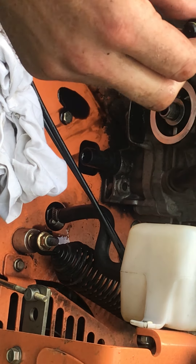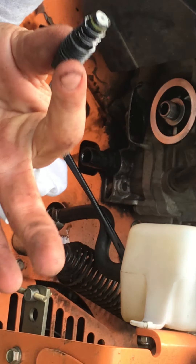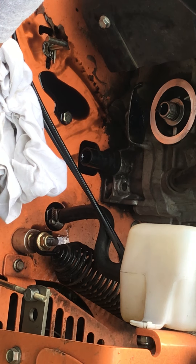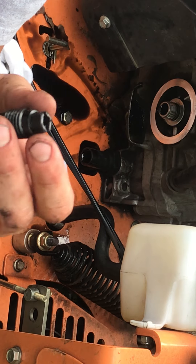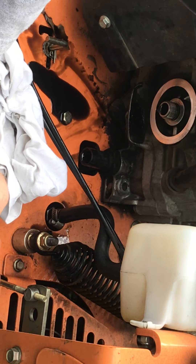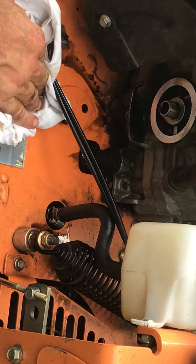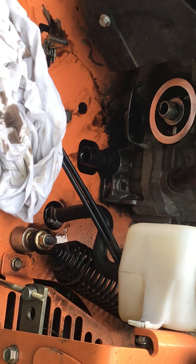Where are you, drain plug? Where's the dipstick? I'm going to have to get another drain plug at some point. Don't tighten it too much, but don't leave it too loose either — if you don't tighten it enough the oil is going to leak out everywhere. And when you do the oil change, don't put too much in. Put in a quart, quart and a half, check it, and see where it's at. This engine requires two quarts of oil and a new oil filter.